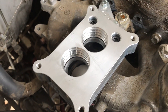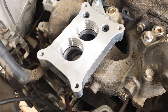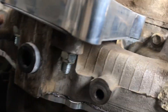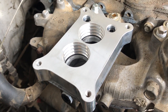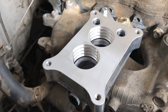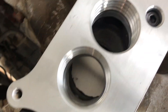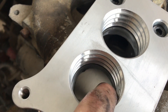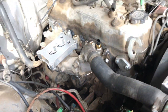This is the adapter plate from LCE. They have a Toyota bolt pattern — there are two studs under here, two right there, two right there — like a Holley two-barrel carb, and that's what the Sniper is based off of, that flange style, so it should bolt up no problem. They tell you to port this a little bit — you can see I matched those ports up real nice. This has got a swirl port in here, actually like big threads, so maybe that'll help too.